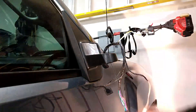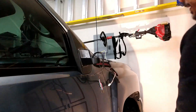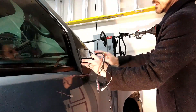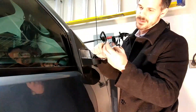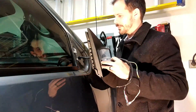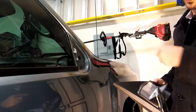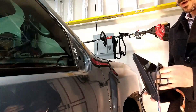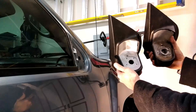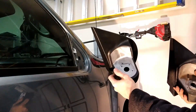I'll go ahead and take this off now and start reassembling with the old wiring — that's what's different. I unscrewed it from the back side, so now all that's left is to pull this piece out. I think I'm going to retain this piece because the way the new motor sits in here it makes sense to use it. But I can't use this wiring — it'll be easier just to use the other wiring because that wiring is one already connected in the door, and two, I think this wire is for the puddle light and the other wire is for the turn signal, and you can only have one. So I choose the integrated turn signal. Based on the differences, I'm going to have to use the new motor with the old wiring.